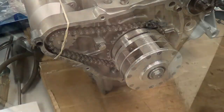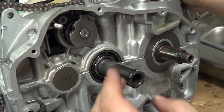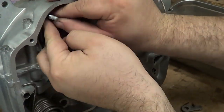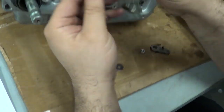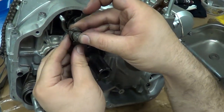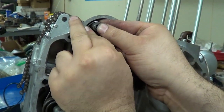On the other side of the motor, we're going to reassemble the shift detent. It's on the stud here and it's got two rollers and also the neutral detent. First step is going to be a hardened washer. Then we have our shift detent spring — it has that notch there, and then this spring is going to butt up against the housing here. We're going to try to get this in here the best we can.